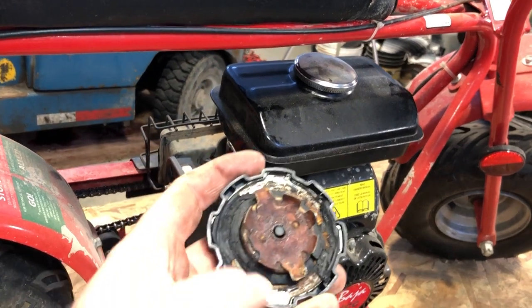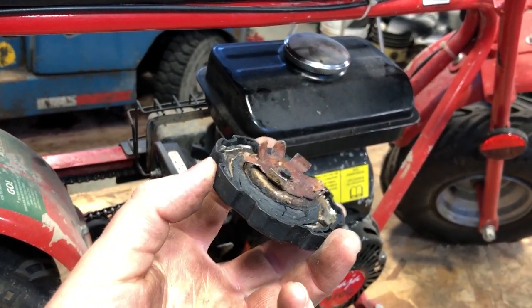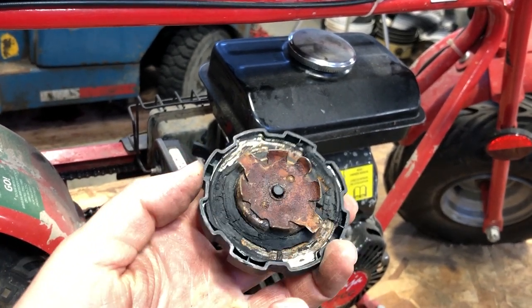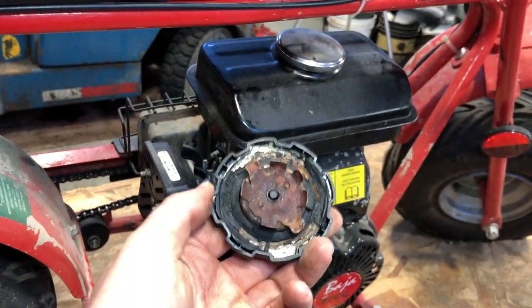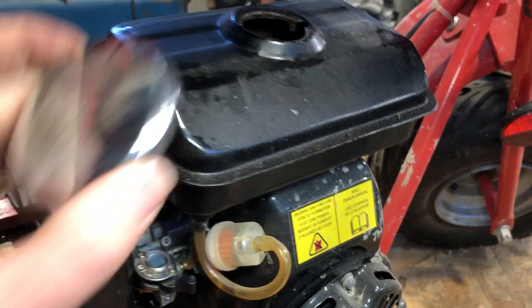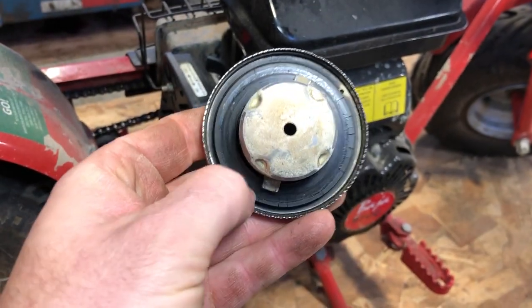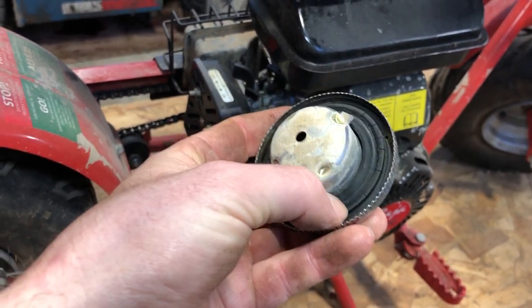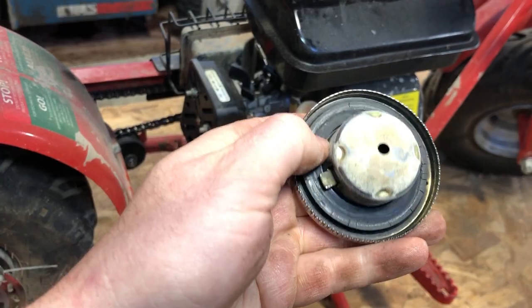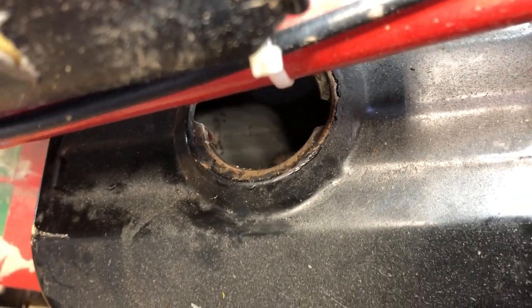One of the worst-affected parts of the fuel system was this gas cap — well, not actually this one; this is the replacement. The original gas cap is plastic, and as you can see, this gasket was definitely not a fuel-grade or gasoline-resistant gasket when they manufactured it. Even the metal here is really badly corroded. The tank wasn't this bad, but this cap was definitely a cheap piece of garbage. I had an old Honda GX gas tank, and this is the cap off of that — for the age of it, probably 20 or 25 years old, you have some mild cracking but it's still soft enough to retain its pliability with no fuel leaks.